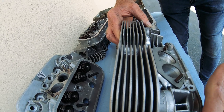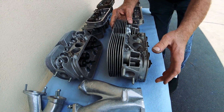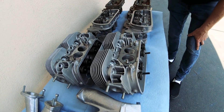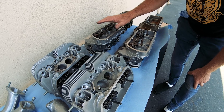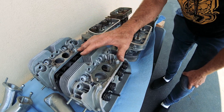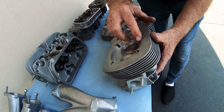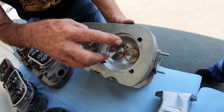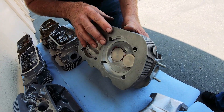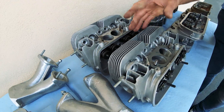They're more of a racing head because they don't dissipate the heat as much. These are more factory high performance, but these are more durable — you can actually fly-cut them down to the spark plug hole for off-road use and get more compression.